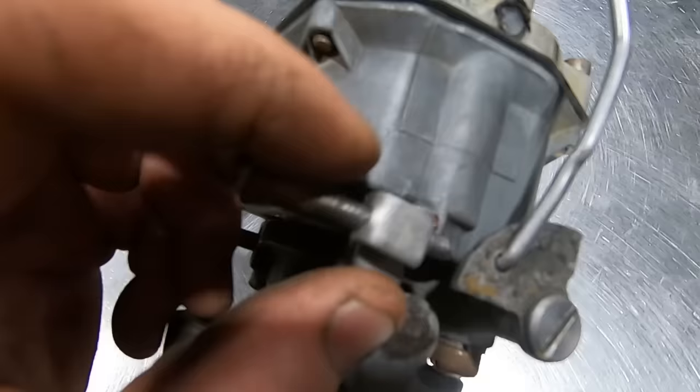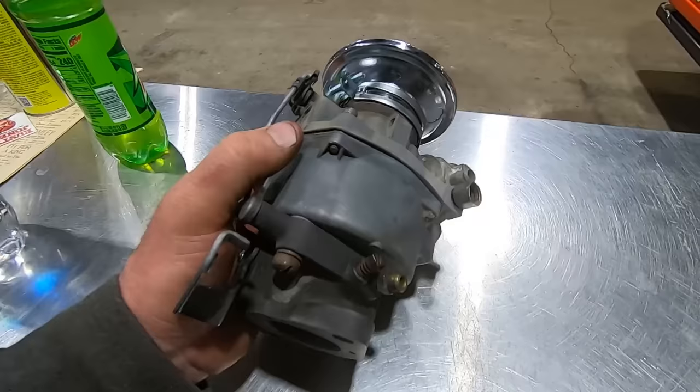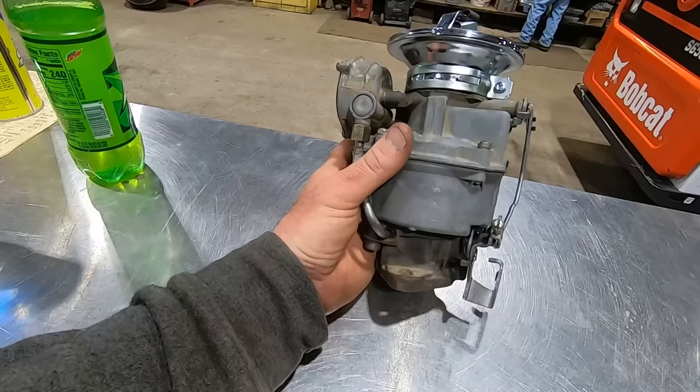And then there's a screw in here too, because I think there's a through hole to put the shaft in there for something. They had a big, long, ugly screw in there, so at least we just cut the head off of that one. And then the accelerator pump was kind of screwy, so we had to take another one apart and get a donor, but old Mojo made her happen. So let's throw this thing on there and see how she works. We know it did not have an accelerator pump before, so it should be way better.